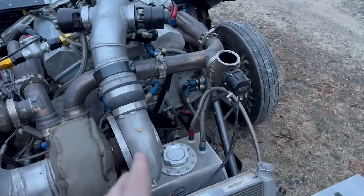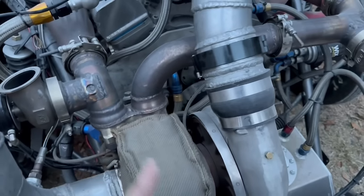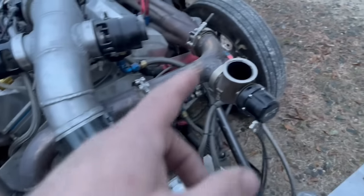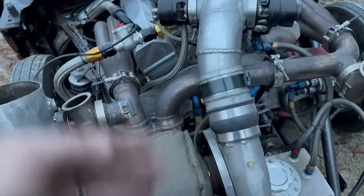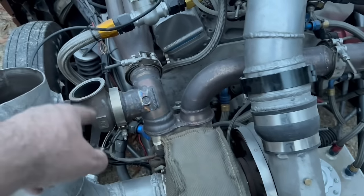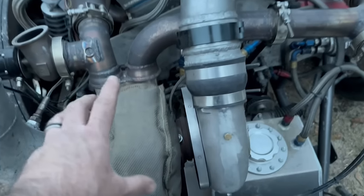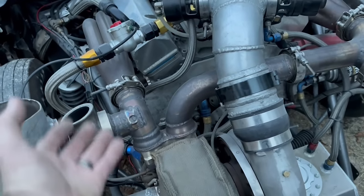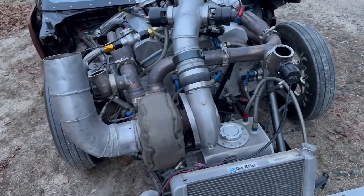When it takes a lot of CO2 pressure to make boost, you often have back pressure issues or you're approaching the limit of the turbo. When the turbo becomes the restriction, exhaust gases bunch up, and the wastegates actually flow more because of increased back pressure. Think of it like a water hose — when the path is free-flowing you don't get much out the wastegate, but when you restrict the turbine area pressure builds and forces more through the wastegate. That's also when boost creep issues can appear.